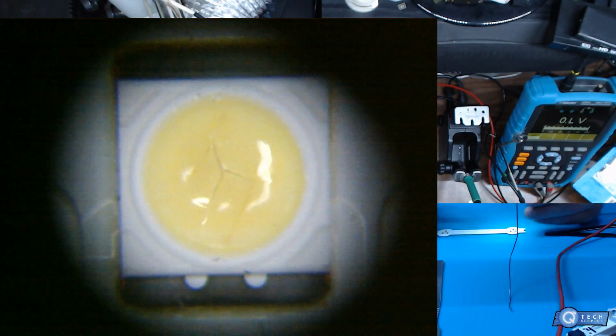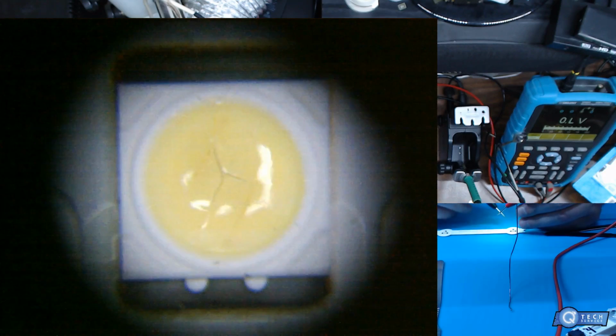Now we're gonna go to the next LED here. Now look at that one. That one also looks screwed up. So would you feel comfortable just replacing that one? Let's see if this one's blown here. This one's pretty charcoaled up too. Can you see that line? A lot of heat, because this rail right here is basically the bottom rail of the actual TV, so therefore it handles a lot more power. I don't understand it, but